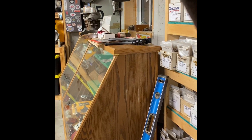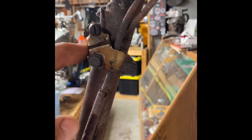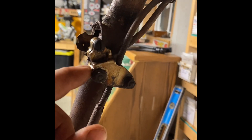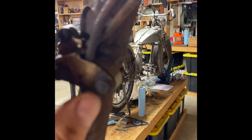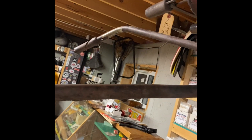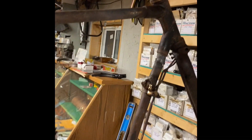You can see there's one cable that comes in here at this angle - that was probably for the throttle. Then this one goes down and would have been for timing of some sort, to advance it. I'm not 100% certain yet, but that's how most other motorcycles are. It's held on by a clamp here, and we're going to heat this all up, save all these bolts, get that off, and then continue working on getting that top handlebar clamp and the fork off. One step closer.